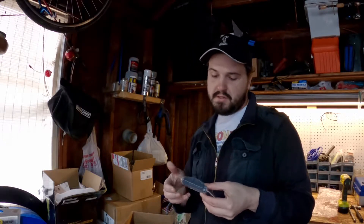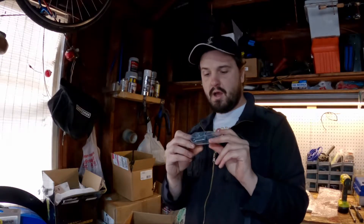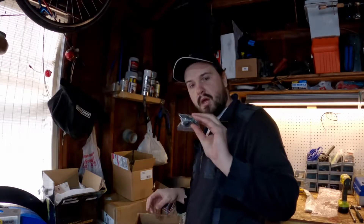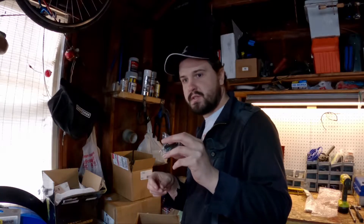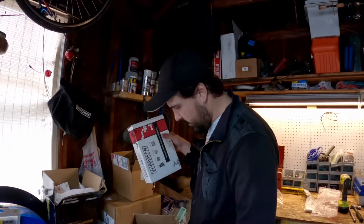Right here is a really important thing — this is a GM three-bar MAP sensor. This is one of the most important things when it comes to boost tuning. Considering that I'm going to switch over to a speed density setup and not use a mass airflow sensor, this is how I'm going to measure my boost levels. There is a MAP sensor on these cars, but it's used more or less for barometric readings, and it's not even hooked up to anything. I'll use this factory location and the wires.